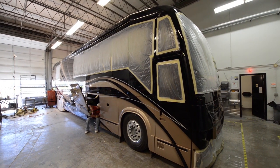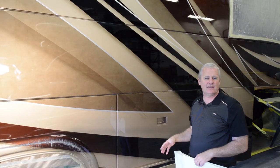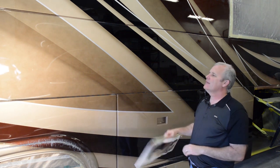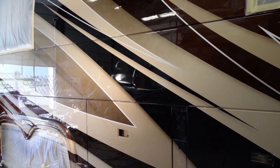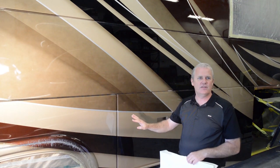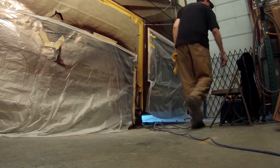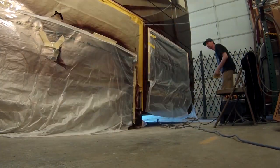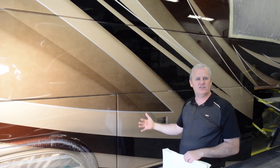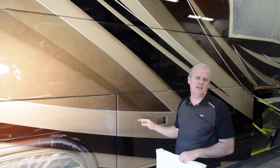It is completely hand laid out — this is not vinyl, this is not some sort of vector graphics. The guys actually take a look at the drawing, hand lay it out, and then build the colors up. This one is in the portion where it's had about seven layers of clear. They put on three at first, then do a whole cut where they sand the whole thing down, then put on another four layers. At this point they've again sanded it — called a cut and buff — then go to finer and finer sandpaper until they're into the buffing process, polishing until every swirl mark is out of it.